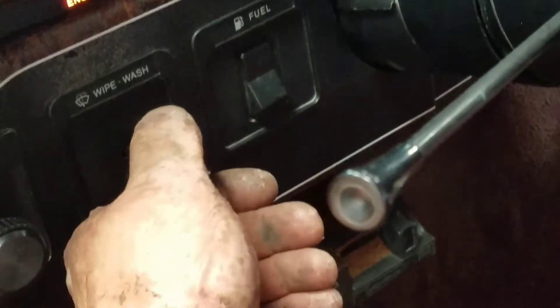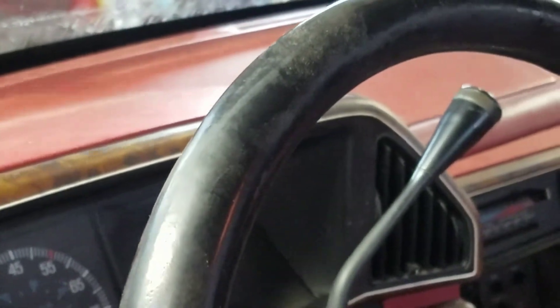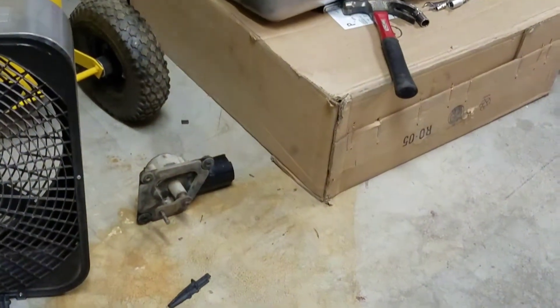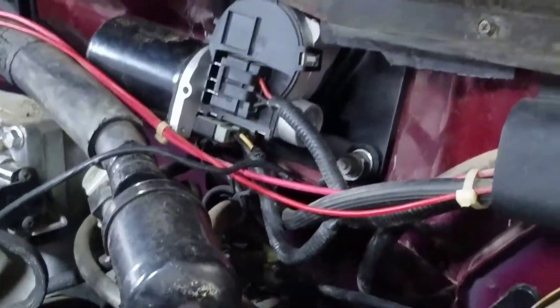I also had to replace the switch here. The only reason I had to replace the switch — as you can see, it's no longer stopping, everything works. I'm happy, I believe that is now fixed. I'm pretty sure the culprit was the motor, because when I was running it earlier I put my hand on it and it didn't nearly get as hot. So I'm thinking the old motor was overheating and probably shorting and stopping.